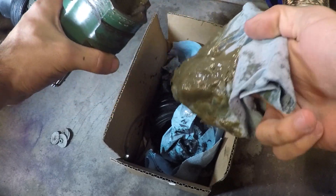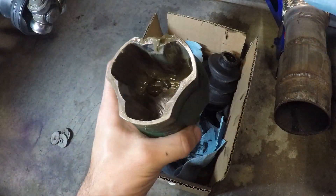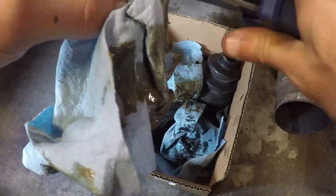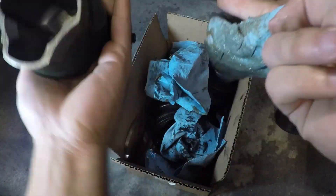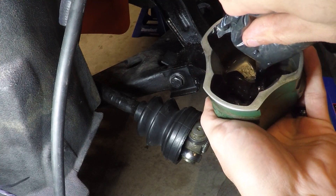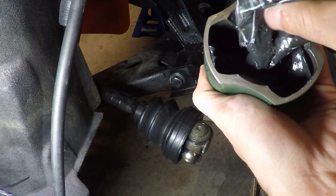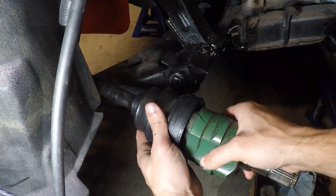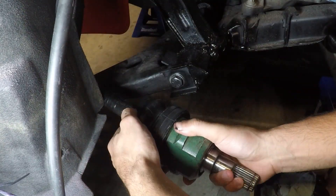You'll want some really good paper towels to get all this old grease out. It's a lot easier to just scrape this stuff out at first before you start shooting brake cleaner or anything else in there. To save on paper towels, I'm cutting them in half and reusing them a little bit. So now that you have everything clean and you've got your new boot on, you're going to squeeze in your new molybdenum grease. The molybdenum is essentially a high shear particle — it's found in a lot of greases, but you can get stuff with a higher content to allow for more shear protection on those friction surfaces to make sure that you're not squeezing out the grease completely and getting metal on metal contact.